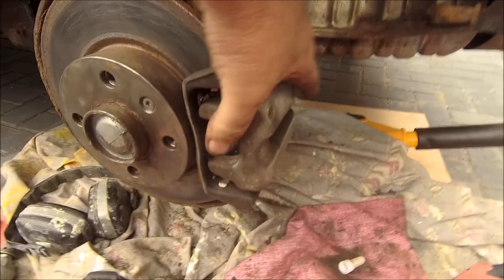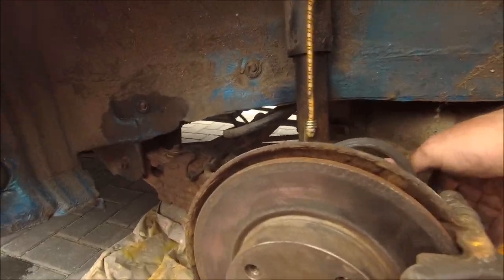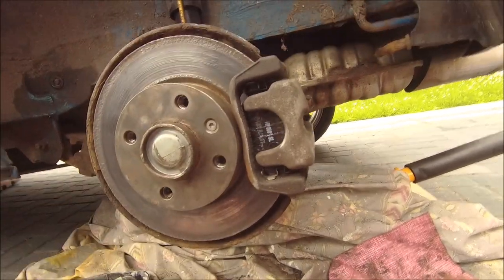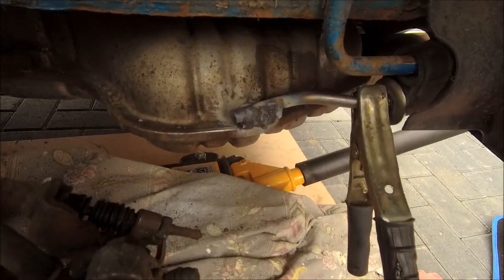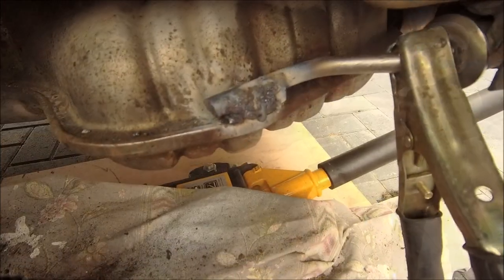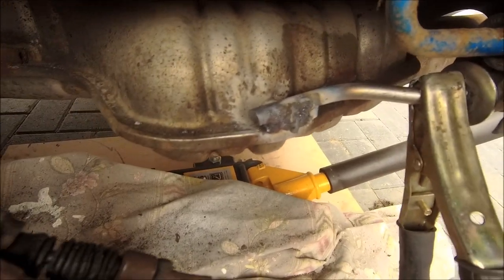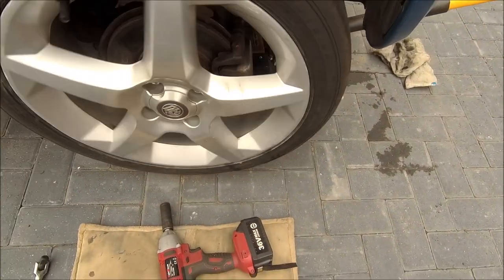The caliper has got some play in it, turns around nice and freely. Let's operate the handbrake — yep, the handbrake works fine as well. Bolt it back together and let's get on to the other side. It's amazing what you find when you start digging around — same as happened on the wife's car, exactly the same place, exactly the same bracket. I've just made a new bracket for the exhaust hanger because it had basically rotted away, just to make the exhaust a little more secure.